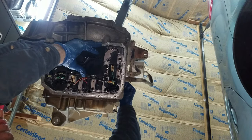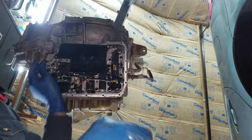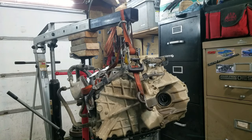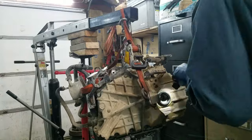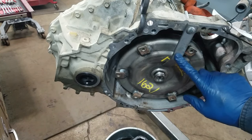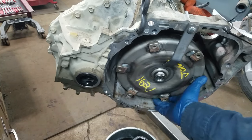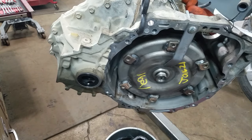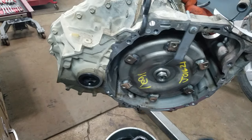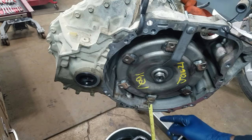I put a little silicone paste on the O-ring so it'll slide up here really nice without causing a fuss. These holes don't line up. I had to order the filter — apparently there's an 18 and a 19 bolt pan and they didn't ask me which and gave me the wrong one. So for right now I'm just going to replace these seals. I got some apparatus on my hoist to make sure it doesn't fall. You always want to watch it with these junkyard setups too — they put this bracket on here to make sure the torque converter doesn't fall out. I actually measured the old torque converter when I took it out: from this tab to the flat on the bell housing it was at three-quarters of an inch, so this one's under a half an inch.